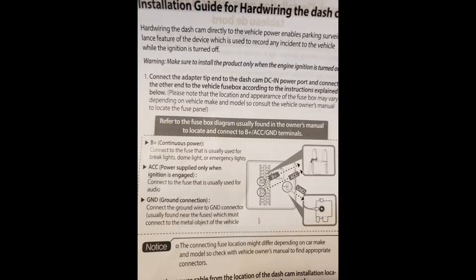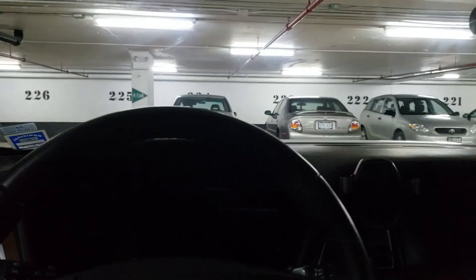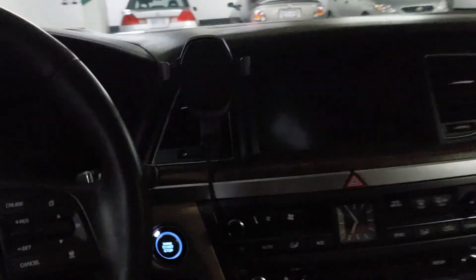There are several ways to connect to your fuses. The first is to simply put a loop on one of the legs of the fuse and plug it in — make sure the wire is neatly adjusted since space is limited. Another option is to buy a special fuse tap extension that goes into the original socket while bringing the fuse out into a specialized socket with wires. Once you're in, there's only one way to find out if it works — press the button and test it.